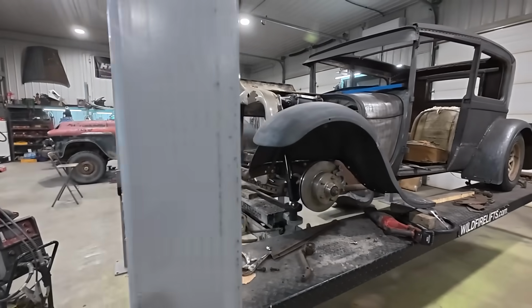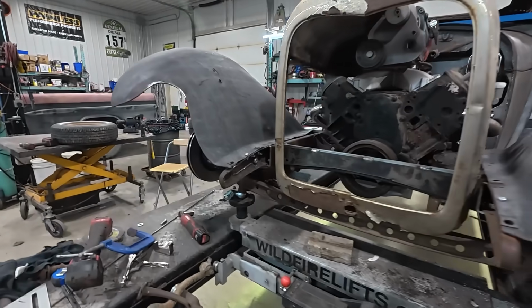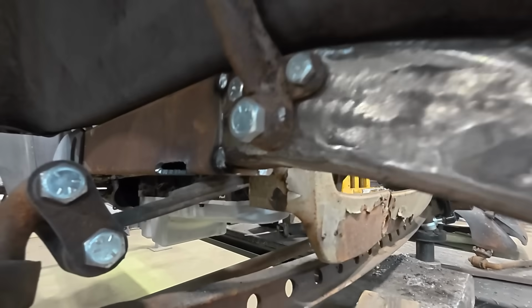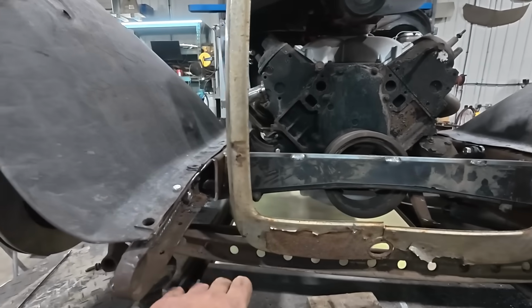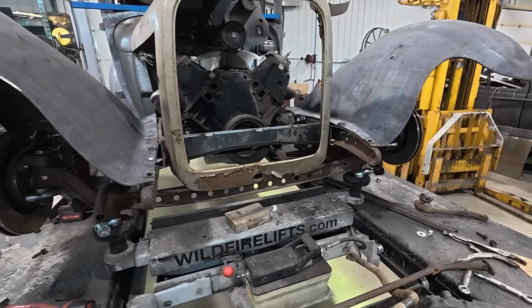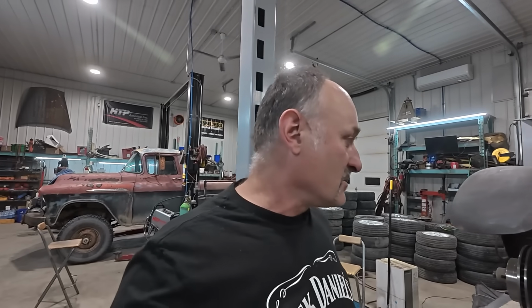So that'll be tomorrow, do that. The horns and stuff, I'm happy where they are, so I'm just going to burn them in. When the chassis comes off, we'll have to do some tweaking down here because it's just a hair off. We also have this mount all open into there. I chopped it open for the spring, so we'll have to do some boxing and things in there anyways. So anyways, it's about where we're at. Tomorrow we'll build some shock mounts and tweak that little brace, and the fenders are kind of mounted at that point.